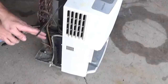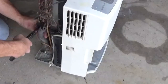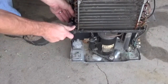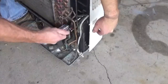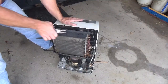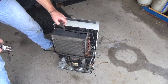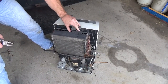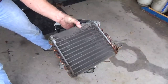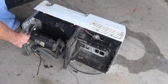Going back to removing some screws, we'll take the radiator out. We've got to cut some small wires — nothing big. This particular dehumidifier had a leak in it, so there is no pressure in the compressor — there's no pressure in this system. It's just attached here with some foam up at the top. Now that I've got all those screws out, very easily go ahead and remove the radiator. That's your moneymaker right there.